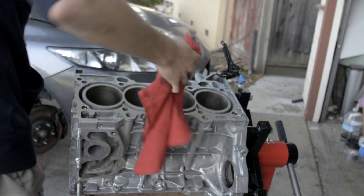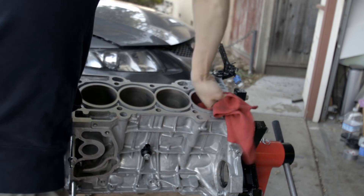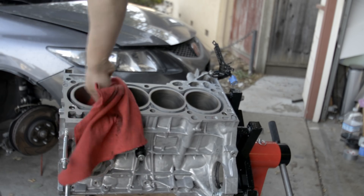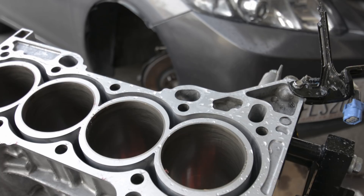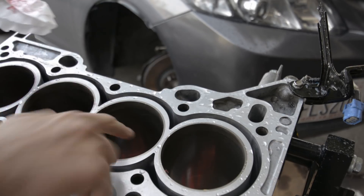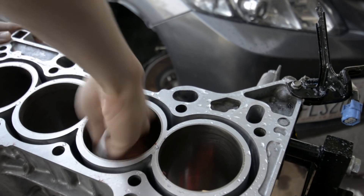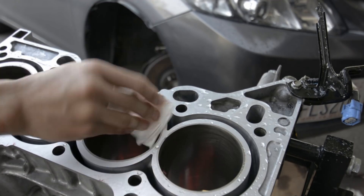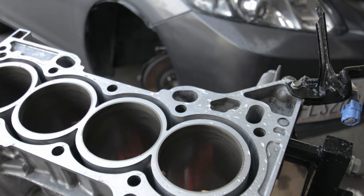Red rags are good for cleaning up oil spills, but when I used a rag soaked in oil and wiped the cylinder walls, it left behind a ton of lint — which is really annoying when you're rebuilding a clean engine. When you look into your cylinders you might not see it with your naked eye, but there's a lot of dust still stuck on the walls that's hard to feel with your fingers too. The only way to tell if your cylinder walls are clean is to wipe them with a clean paper towel or — what I like to use — a coffee filter. Most likely it won't be clean, and you'll see a lot of black or brown stuff. Coffee filters are cheap: you can get a pack of a hundred for just a few dollars at your local grocery store. You can easily see the dirt on them, plus they leave no lint behind, so they're perfect for wiping off journals, bearings, and all that stuff.